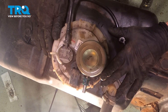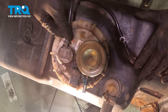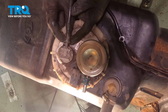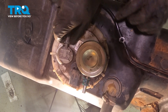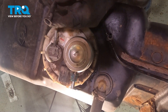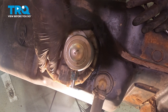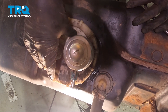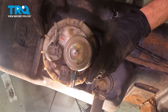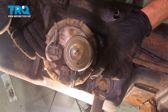Once you have your fuel tank down to a workable position, we'll continue on to removing this line across the top of it. There's an area that you want to try to squeeze together and once you have those two ears squeezed, we can pull this right off. We'll just give that a quick inspection. At this point, we can continue on to removing the locking ring that's holding the fuel pump assembly down to the fuel tank. To remove this, make sure that you remove any debris from around this area so nothing falls down inside of the fuel tank.